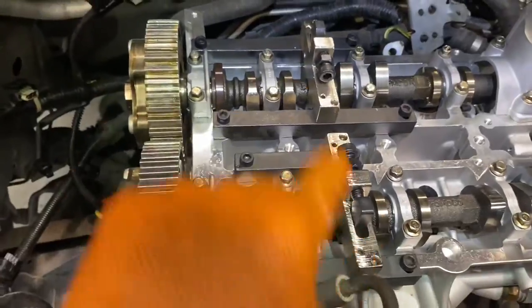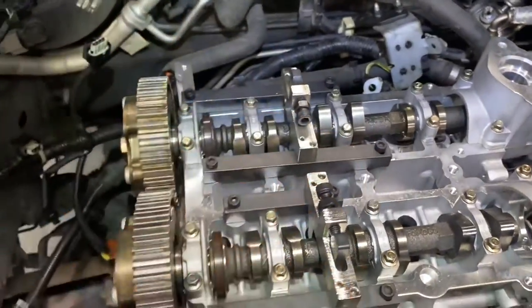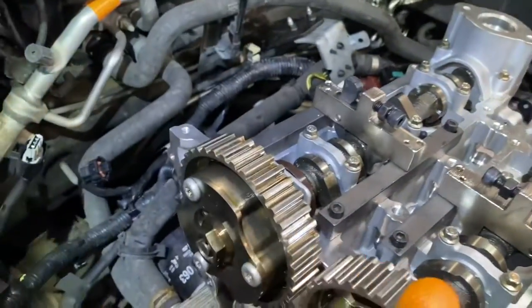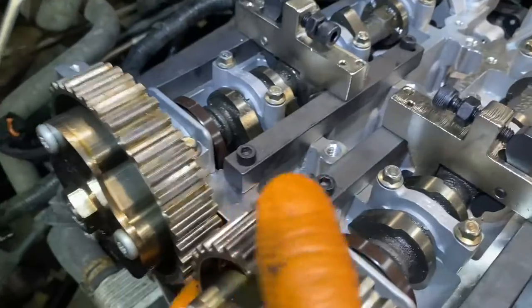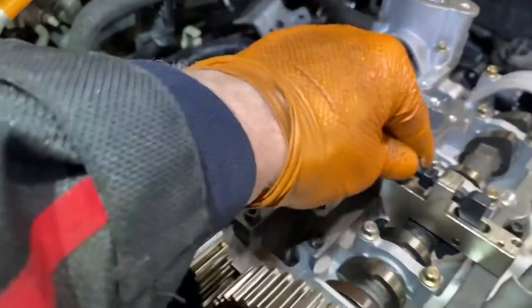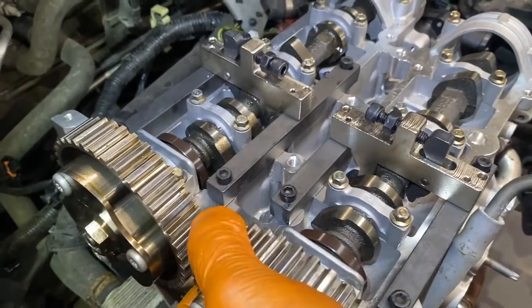The locking tool lets you fine-tune alignment — there's a little bit of movement. I may need a 6mm Allen key to shift the whole thing slightly, but I won't be too fussed. I also didn't take the starter out this time — on the last occasion I had the sump off to mark the flywheel, but this time I have the locking pin in the back. I'll torque the crank pulley and assume if I go too hard I could bend the locking pin, so I'm using logic.